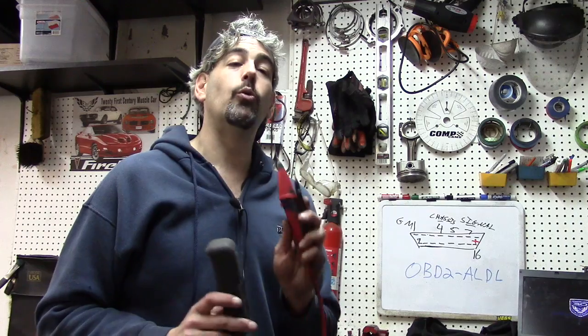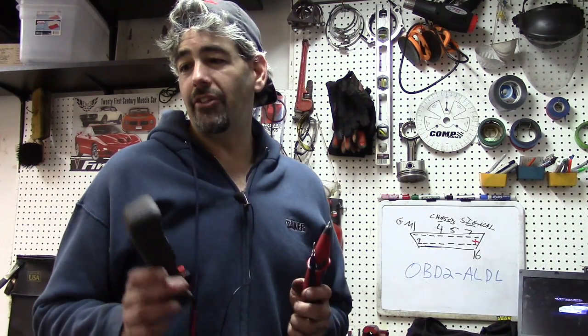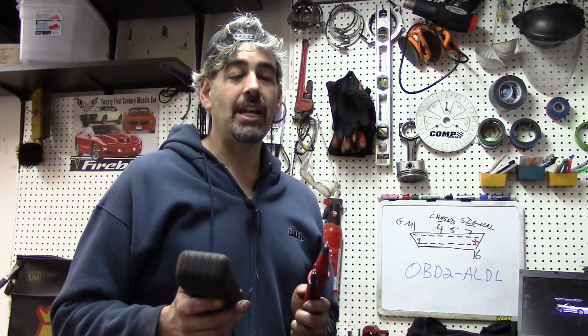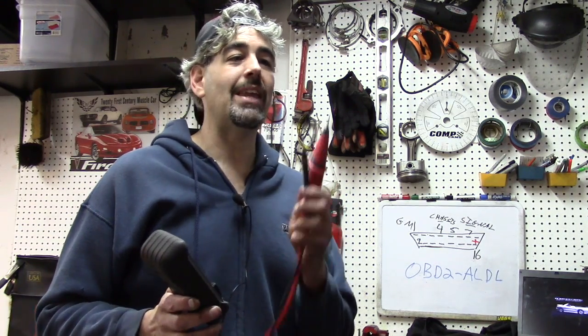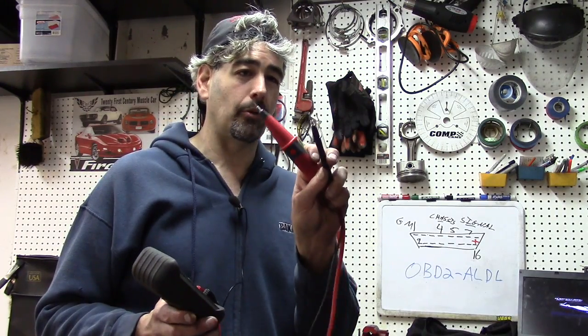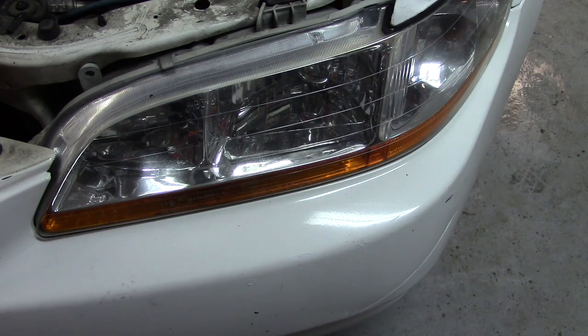I've actually played around with it a little bit, and I will tell you I actually do really like it — I think it's certainly worth 70 bucks. So what I've done is I've set up a little bit of an application here where we can test this instrument, and it'll help you to totally understand the advantage of having the Load Pro leads as opposed to your usual multimeter leads. For this example, I've set up one of the most simple applications you could possibly have as a do-it-yourselfer: headlight won't turn on. Let's go ahead and turn on the lights and see what happens.